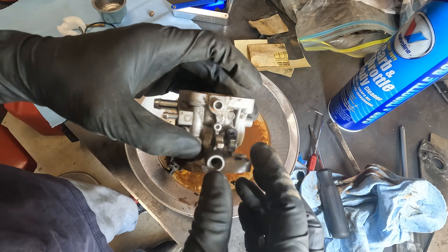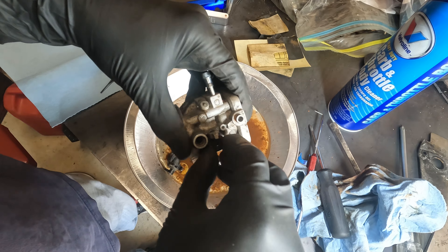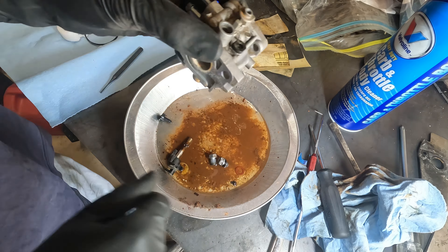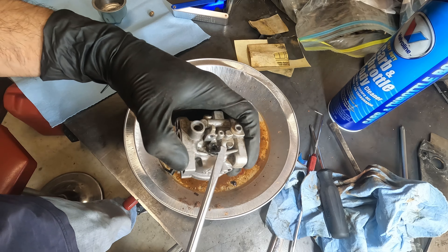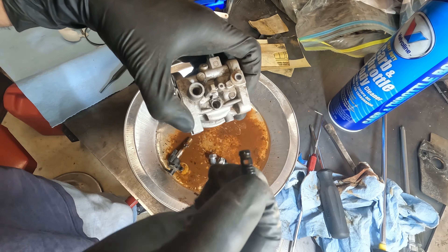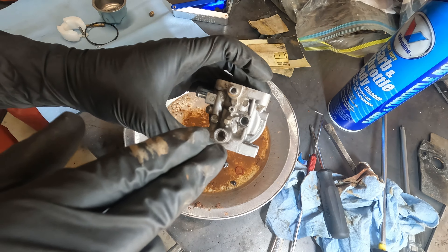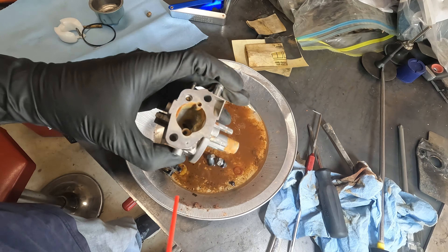Let me hit this with the air gun and see if I can blow any of it out, then we'll come back with the carb cleaner. This is the idle set screw — or actually I think it's an idle air mix screw. We can pop this out and this is another small jet that can be cleaned. We can see there is goo in there, so we'll clean that. Now that everything is apart, let me blow this out with air first then hit it with carb cleaner. Blew it out with some air — still pretty crusty but all the big chunks are out.